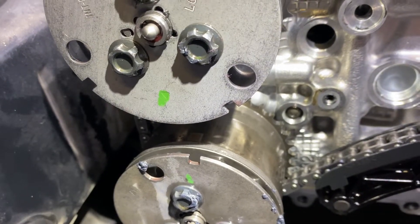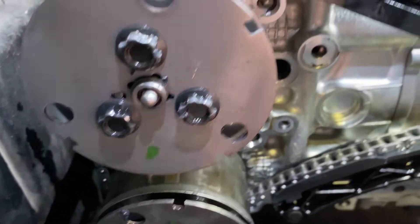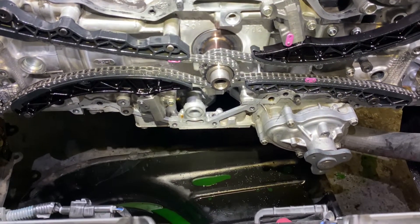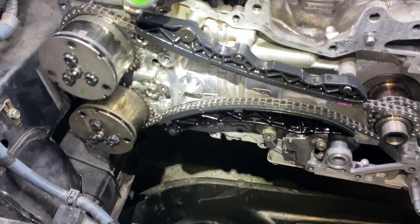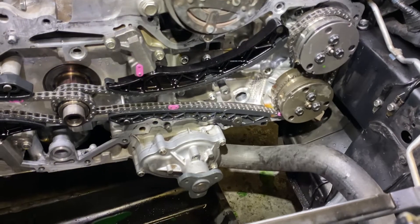This one's not perfect — the timing is a little bit off, we moved it slightly too far — but we've double-checked it. What I've learned when checking this: if the chain can go on the next chain link, you're one link off. If you move it one chain link either way, there's only one way you can line it up correctly. Just make sure you're getting it as close as possible and everything should be good to go.